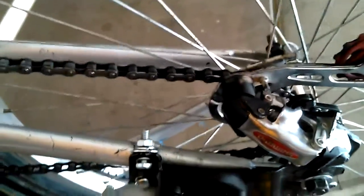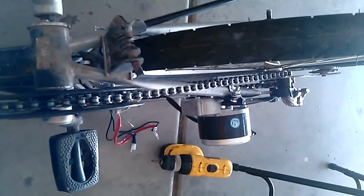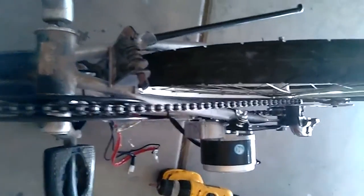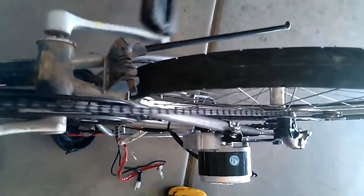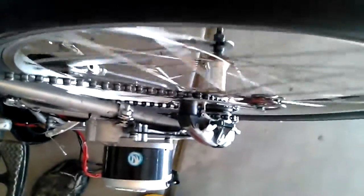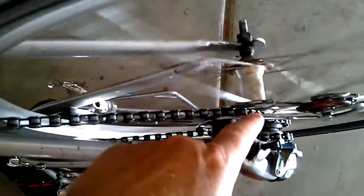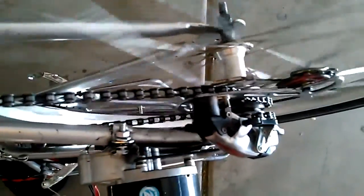The key thing I want to show is that I reused this chain tensioner. Notice the chain does not go on the back sprocket. I was able to get it to line up using just the bottom wheel on this chain tensioner, and I could get it lined up fairly well. The chain goes to the left just a little bit, but it stays on in both directions — forward and backpedaling. The only remaining issue is there's still a scraping sound as the chain drags across the chain tensioner, which I'm going to have to adjust.